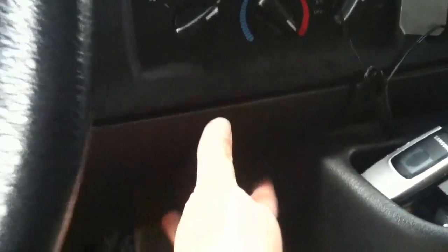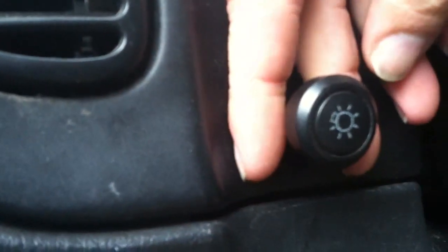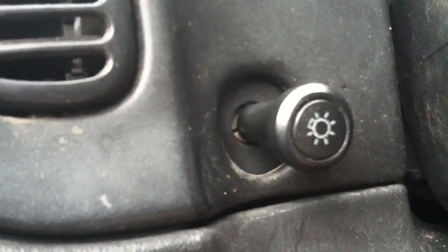This panel is a separate panel from the rest of the dash, so when you're smacking it back in place just gently get all the little pressure points seated. The lower panel gets screwed back in — there are little pressure points and then screws underneath to reattach. There's also a fuse box cover on the side. At that point make sure you've inserted your switch handle all the way in — I didn't have it fully inserted at first and it wasn't quite right — but as soon as it pushes all the way in and snaps, you're good to go. The other function is that you turn it to turn on the dome lights; function test everything before you put all the screws back in.